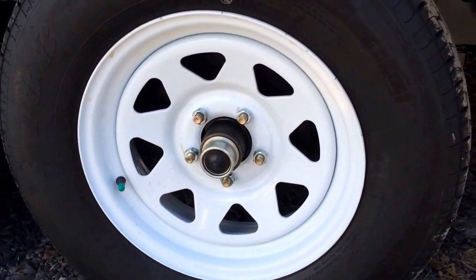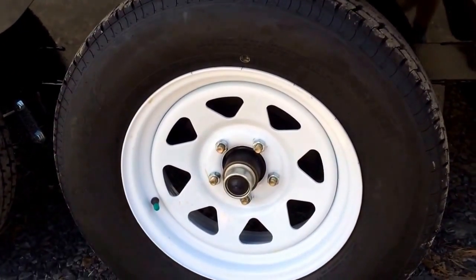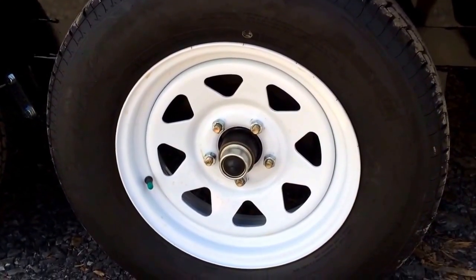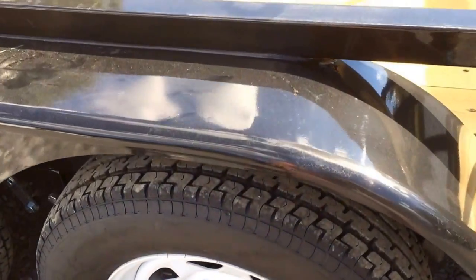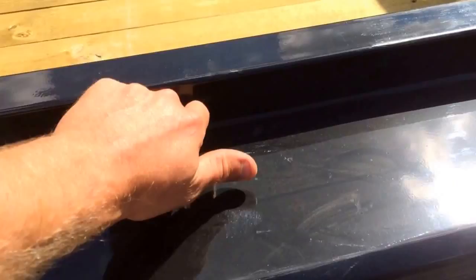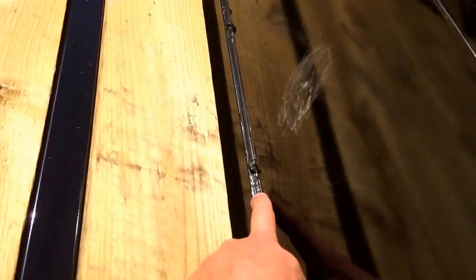Brakes are on both axles as required by Pennsylvania law. The tires are radial tires, now standard — a 205/75 R15 six ply. Notice the easy lube hubs as well. ShoreTrac does a nice job with their fit and finish: they take silicone and shut all your joints, which are traditional rust areas on a trailer. They do it on the outside and also on the inside of your fender backers and down at the bottom as well.